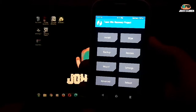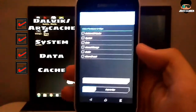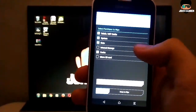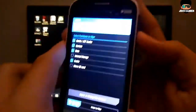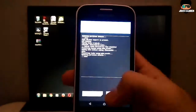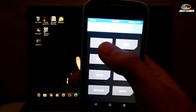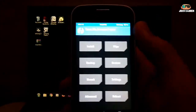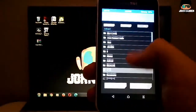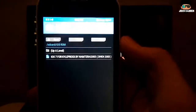There are 8 boxes of choices. Choose 'Wipe' and select the following. After you wipe your data, go back to the 8 boxes and choose 'Install', then find the ROM that we downloaded. Tap the file, then swipe to flash. It will take a few minutes to finish.